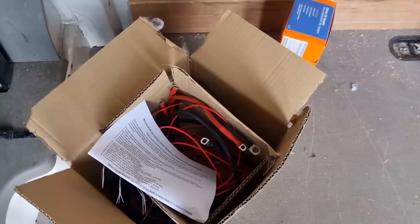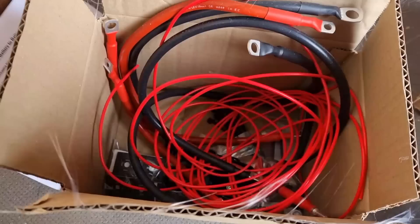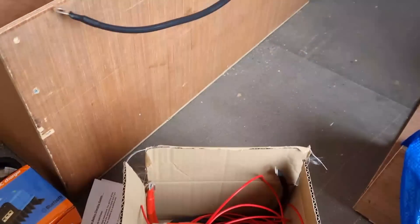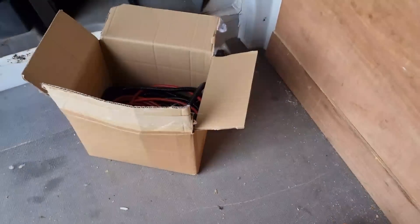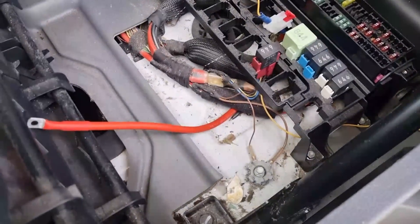You go for the non-isolated if you've got a van and the isolated if you've got a motorhome. We've got a ton of wires, extra clips, instruction manual, more extra conduit - everything already cut to length that you actually need. The reason I went for this kit is because it's already crimped and heat shrinked. I don't have the tools to crimp them safely and properly.